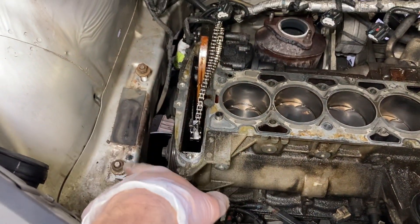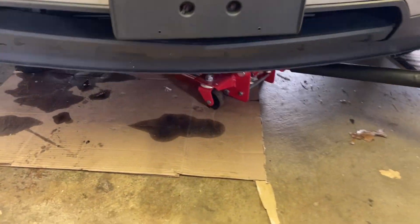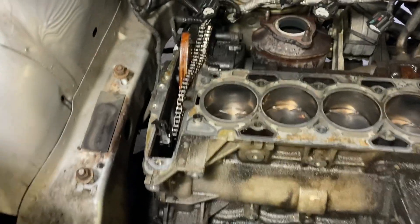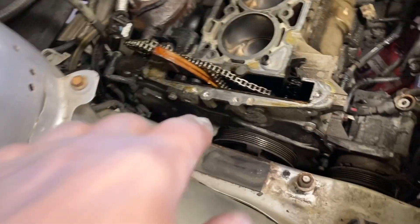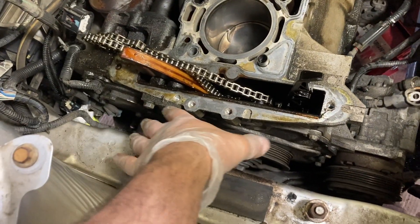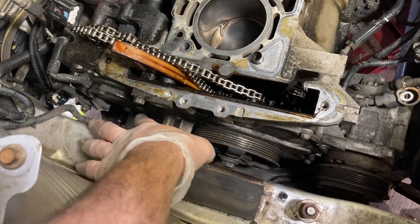Here's where we're at now: I've got the motor mount taken off. I put a jack underneath the engine with a block of wood on the oil pan to keep the engine up. There are two mounts — one mounts to the frame, then attaches to a block that bolts to the engine. I took off the one going to the engine; it has three bolts, with two in the back easier to reach with an open-ended wrench.